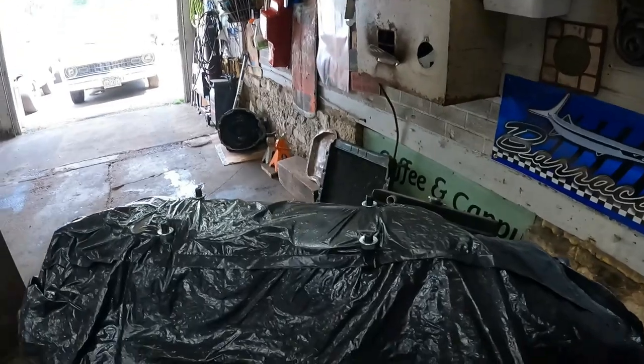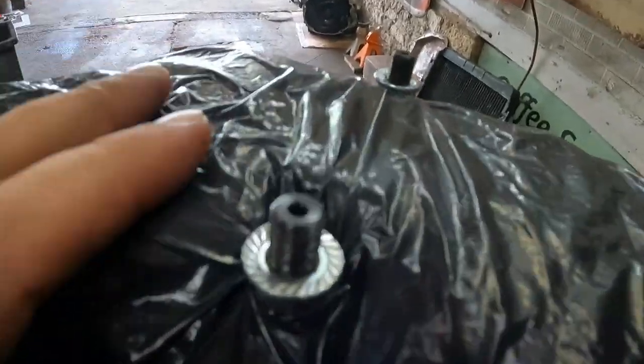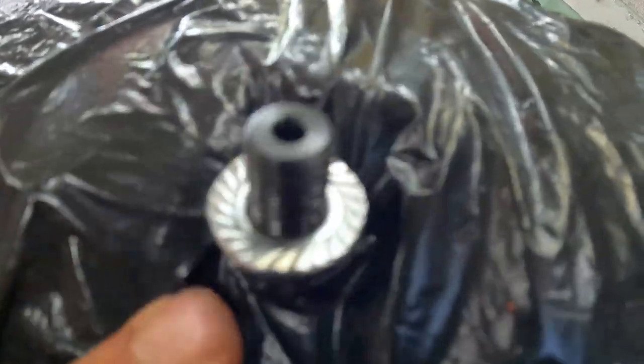Right now, we notice there's interference with our windage tray to our oil pan baffle. And we determined that we're going to have to cut the studs from the windage tray bolt kit down. They're interfering. Well, that's going to create a lot of metal shavings. It's going to contaminate an area. Sometimes I have a decent idea. I'm going to see if it works. I covered it with a trash bag and ran the hardware up through it.